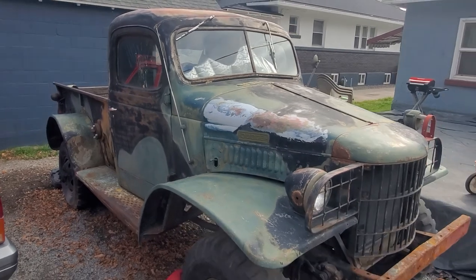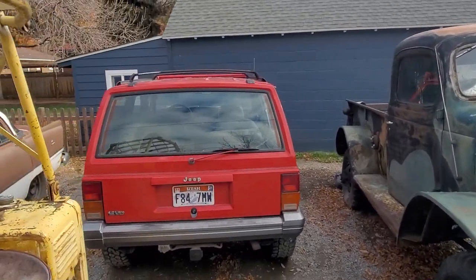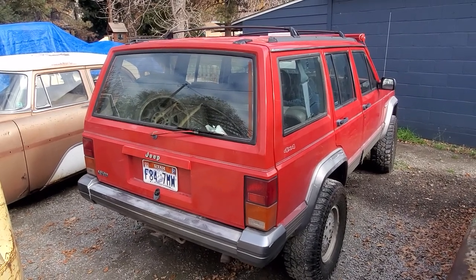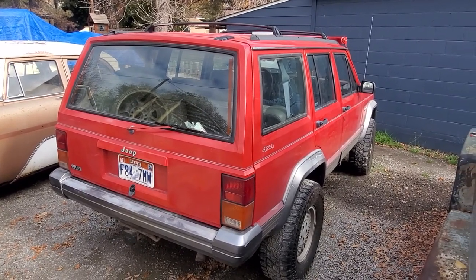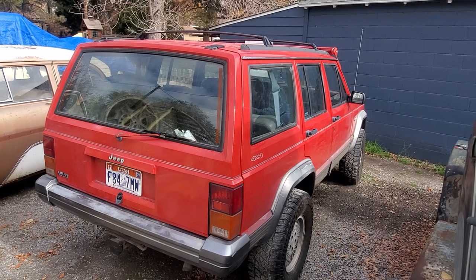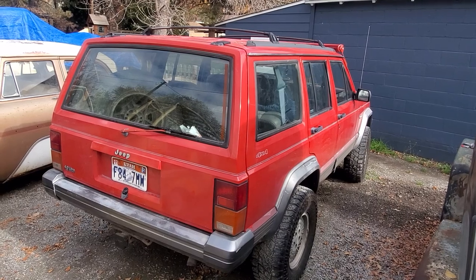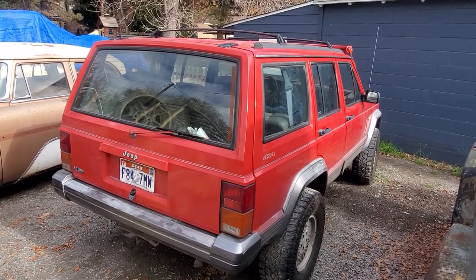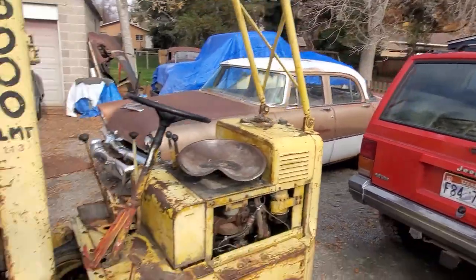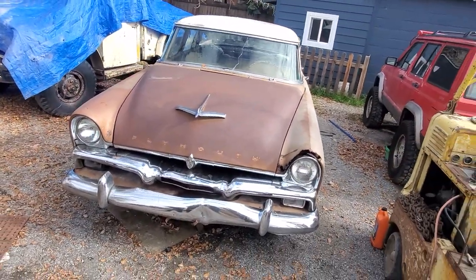Like, comment, subscribe - hope you guys are enjoying the content, I'm trying to bring it to you as fast as I can. Next up is repairing this poor Jeep - we dropped a lifter. I don't know if it was low oil pressure or what did it, but right after we finished the lift on the front of this, that lifter just absolutely took a crap. So I'm just going to go through and change everything on it - redo lifters, new cam, timing set, bottom end bearings, brand new high-flow Melling oil pump. She's getting it. 282,000 miles - she deserves it. I'll catch you guys on the flip side.